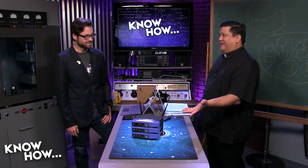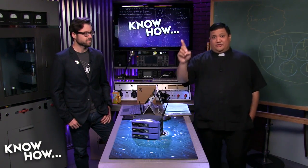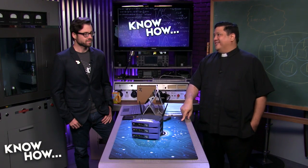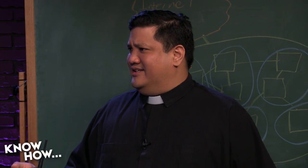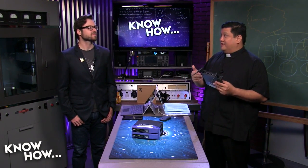It's hard to believe that these are 15 years old now. It's the first router I tried using DDWRT on, which is what we want to talk about. The one caveat to doing three dumb routers is you need to make sure your router is up-to-date, which is not going to be easy if you have a 15-year-old router. Linksys — well, it's actually not even Linksys anymore; it was Cisco Linksys for a while, now it's Belkin Linksys — they stopped making firmware for this router in 2009. Which means if there are any exploits that have developed for that firmware since then, it will always be vulnerable. Which is why, if you're going to do this with old hardware, I would suggest you only do it with hardware that can be upgraded to DDWRT or OpenWRT.